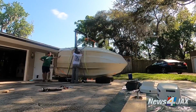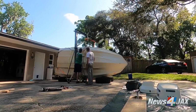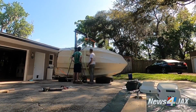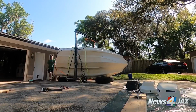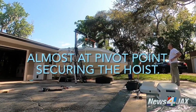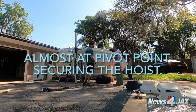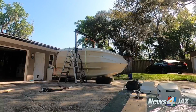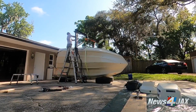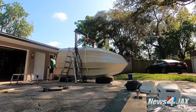And here, grab the ladder once again and put another cinch strap on the top of the hoist so that it cannot move left or right from where it is. That's our center point, and from there, we can start to let it down. But we've got to take that gut check once we get it set and give it the little shove to make sure that everything that we've pontificated about was going to hold true.